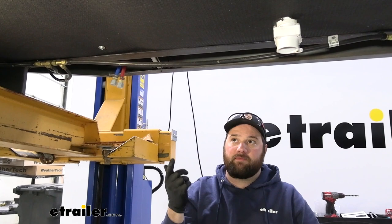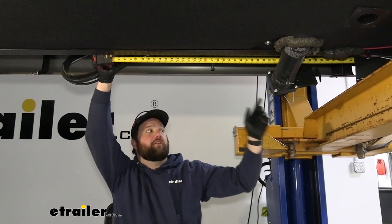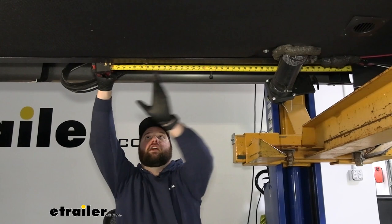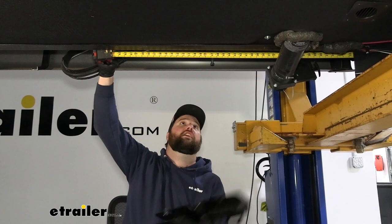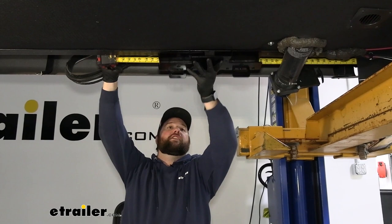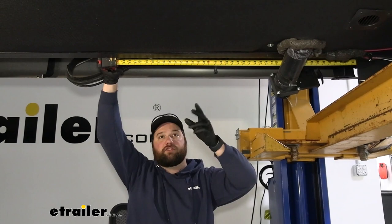For the measurements for the front jacks, you'll want to put your front jack within 60 inches of the front of your camper. So this is our 60-inch mark — we can put it anywhere here, and that 60-inch mark is going to be the center of this bracket or the center of the foot on your front jack. We're going to put the center of our front jack at four feet to get a little bit further forward for more stability, then do the same for the other side.